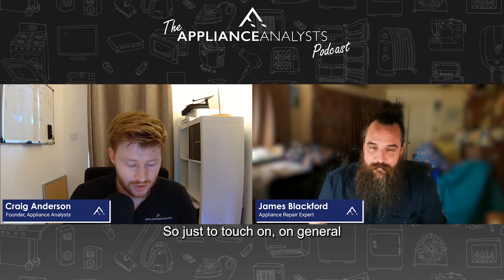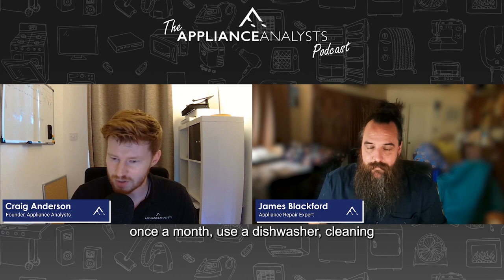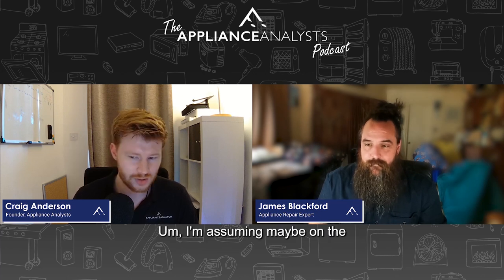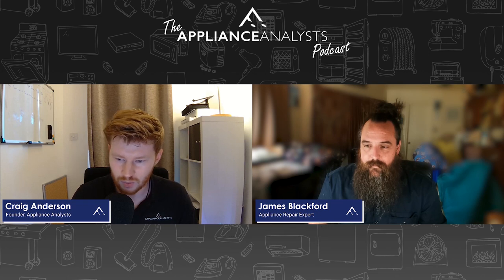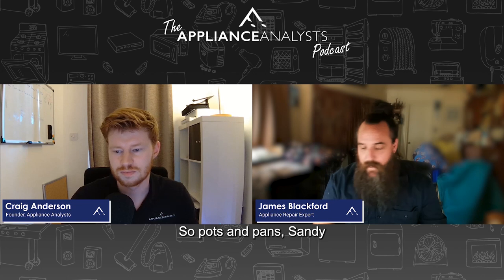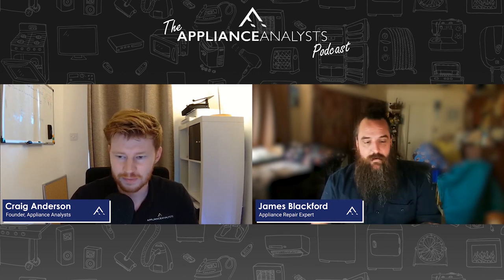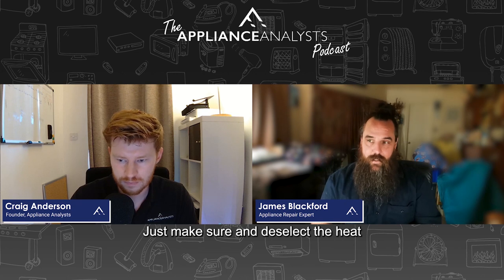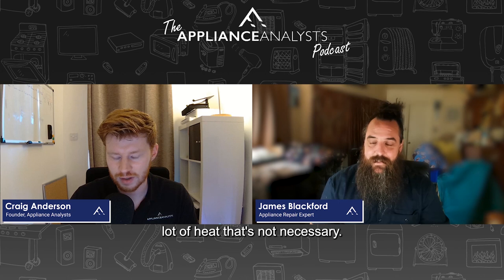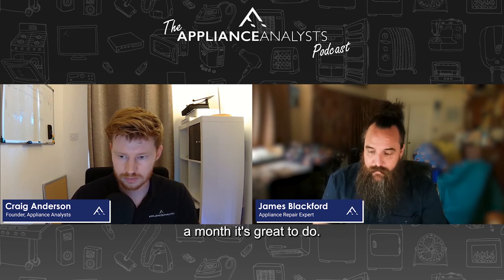So just to touch on general maintenance and things that you would recommend people do: about once a month, use a dishwasher cleaning tablet, run it on empty, and I'm assuming maybe on the hottest setting, or what would you recommend? Yeah, the longest, hottest setting, so pots and pans, sani rinse, high temp wash, whatever you can do there. Just make sure to deselect the heat dry feature, because there's nothing to dry, so it's just a lot of unnecessary heat. Gotcha. Yeah, that's the only thing you want to turn off, the heating element. But definitely once a month, it's great to do.